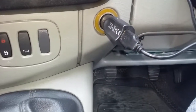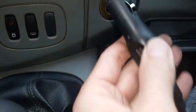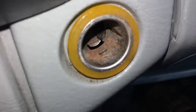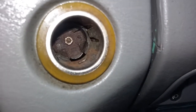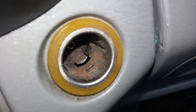So what basically happens is we pull this out — the connector is fine, there's nothing wrong with it, all the ends are clear, no rust, nothing. But you look in here and this is a pretty good example: you can see that it's started to rust. When you get rust inside, that will usually indicate that the connection is not going to make a good connection and you'll have problems.